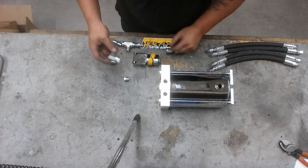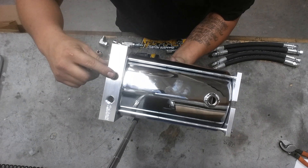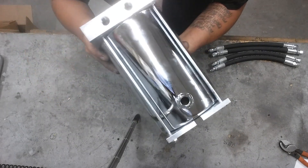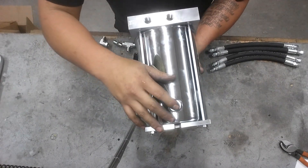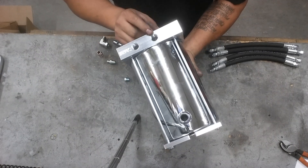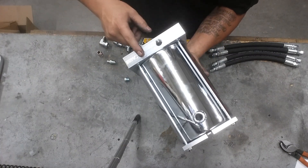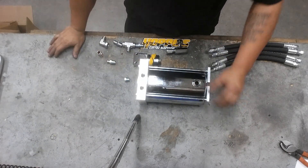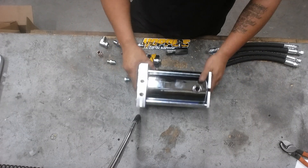This is the basic pump — there's going to be pressure and return ports. If you're mixed up and don't know which one's which, the easiest way is to make sure there's no tank plug on it, then blow through it. If you blow through a hole and you can hear air coming out of the tank, that's going to be your return side. The pressure side is more towards the center. If you try to blow through that one, it's just going to be stuck — you won't be allowed to blow through it, and that's your pressure. So remember: your return is going to be free flow.